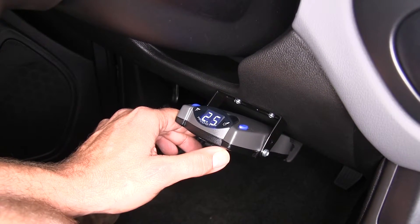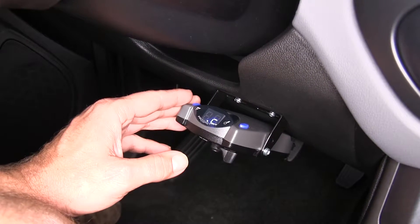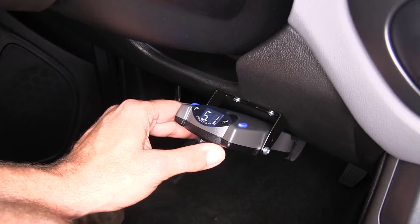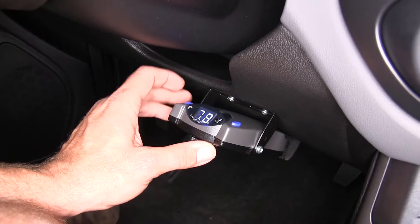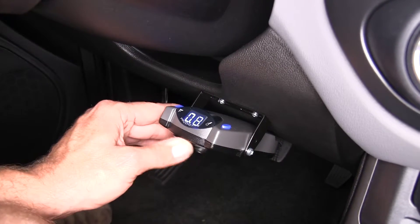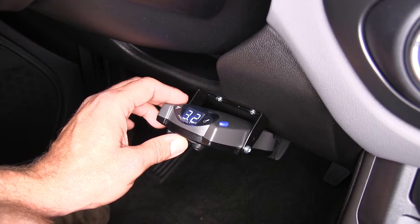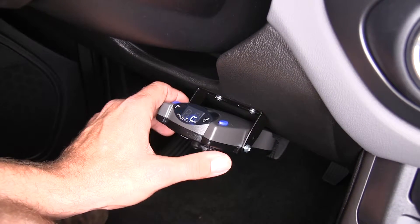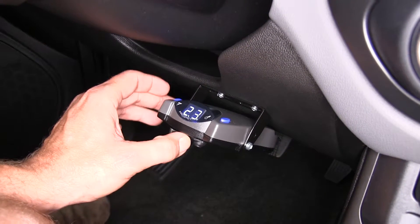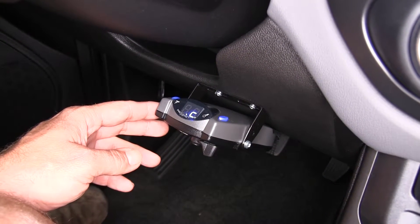The manual override lever on the bottom is generally used to either test the setting of your controller or in an emergency sway situation. This allows us to apply the brakes on our trailer up to whatever our preset gain is, so we don't have to worry about overpowering. If we've got it set at 2.6 or 2.7, that's basically where it's going to end. So at 2.3 for example, all the way over it's going to be at 2.3. We're not going to lock them up, but by just applying the brakes on the trailer and not the truck, most of the time you're going to eliminate that sway.